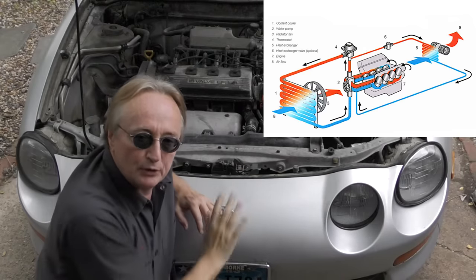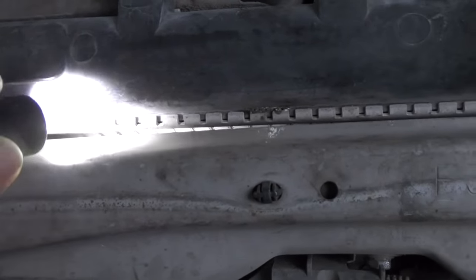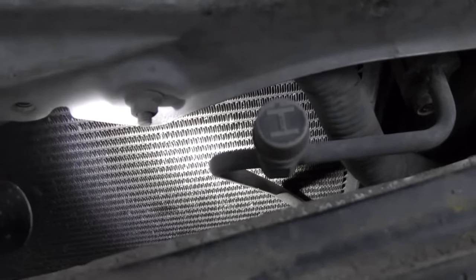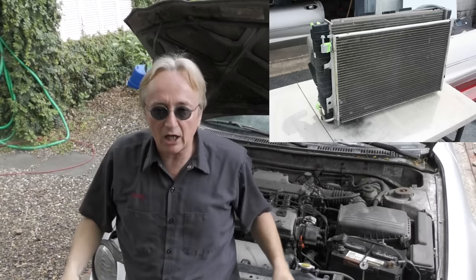Make sure you have good airflow going through the radiator. Plastic bags can get sucked in there, and if you live out in the country and drive at night a lot in summer, you're going to get it covered with bugs. Those little holes the air goes through get blocked and it's not going to cool right. Also remember the condenser is in front of the radiator on most modern cars, so you have to check the condenser too. Make sure neither is covered with bugs, plastic, or anything stopping airflow — especially in summer. Check it regularly, because if bugs bake on they'll be really hard to get off. Hose it down regularly and they come off much easier.